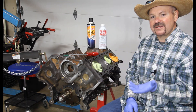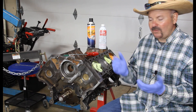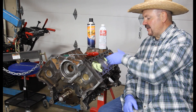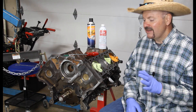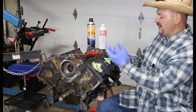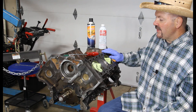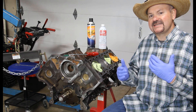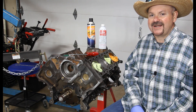When I'm done with that, I take another shop towel, soak it with standard motor oil, and rub that on all my cylinder walls to lubricate them. The next step is to just rotate the motor on the crank so I get the next piston up to work on. And so that's my process — that's how I work through it. Let me show you how it's done in detail, and then I'll show you a before and after shot.